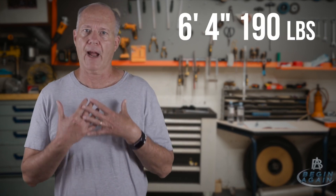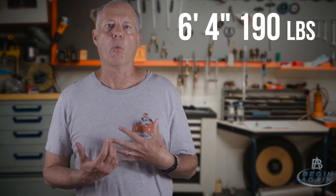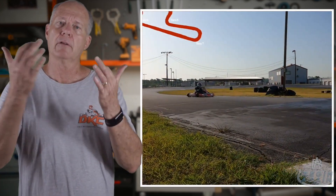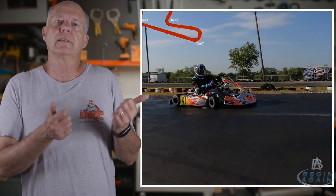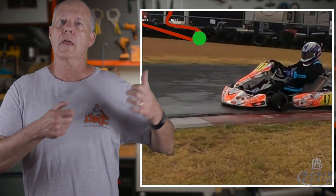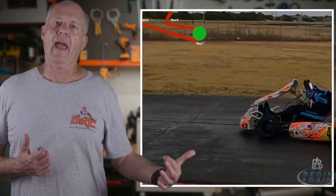It's very simple, it's very effective, but tuning it becomes a problem. This is where my height and my weight start getting in the way of the cart working as it was designed. Basically, my weight is too far back - in theory it's too far back to truly lift that inside tire off the ground. So when I turn into the corners, I get a push, and I have that inside tire dragging me down and slowing me down as if I had the brakes on, because it cannot get rid of the energy that it needs to get rid of.